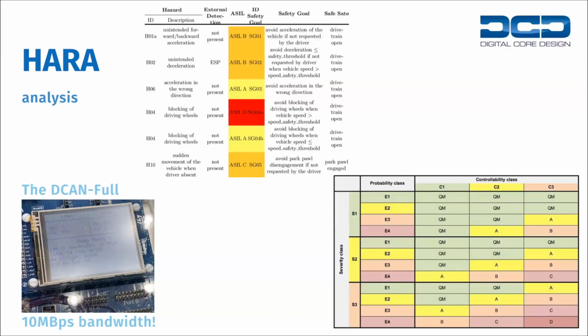We need to detect the most failure modes that can lead to safety goal violation. To do so, one should estimate these three factors shown in the table on the right side. Exposure: how likely is the case to happen? How possible is the system to fail? Next, controllability: what is our ability to control the failure? Is the driver able to handle it?